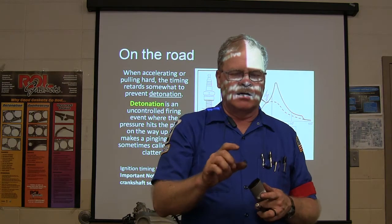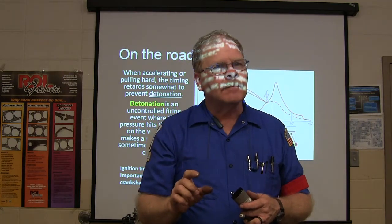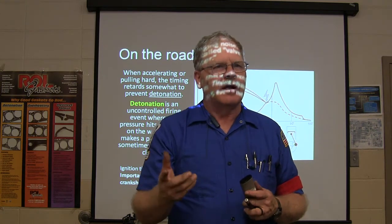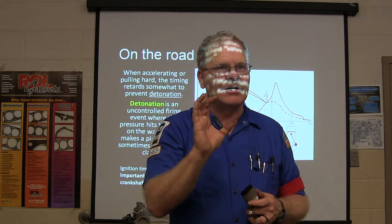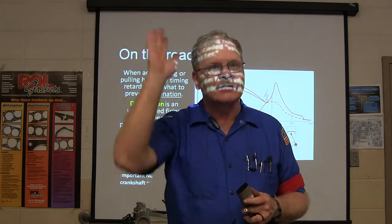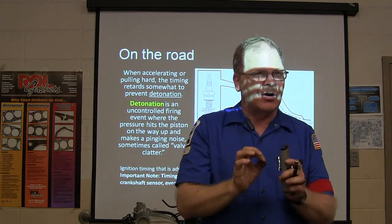So what we had was 1,300 ohms on that one, and it might start and it might not. So I called them, it's only another Intermotor, it had 1,200 ohms, and it might start and it might not. And so I got a Mercedes sensor, Bosch actually, put it in there with 1,050 ohms like it's supposed to. You've been driving it ever since. It runs like a sewing machine. But the fact is, if you buy an aftermarket sensor, measure the ohms.